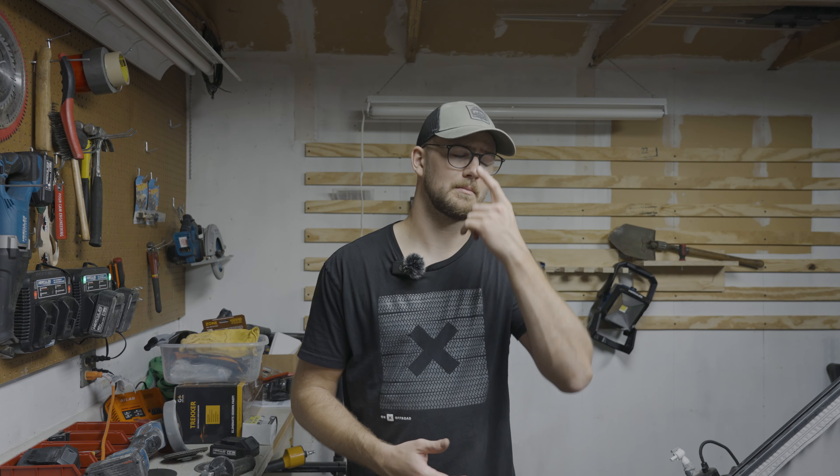These are just really compact systems — roughly three inches by five inches for the whole entire thing, which is crazy how small they are. I was blown away. I also just like this little compact turnkey kit from Blaze Off-Road because a lot of us have seen the big kits with huge fuse panels before and you really don't need all those slots. I've run dedicated power for a radio, a USB adapter in my dash, and to my rear molle panels — and that's it. The fact that this has four spots just seems perfect and doesn't take up more space than it needs to in your engine bay.